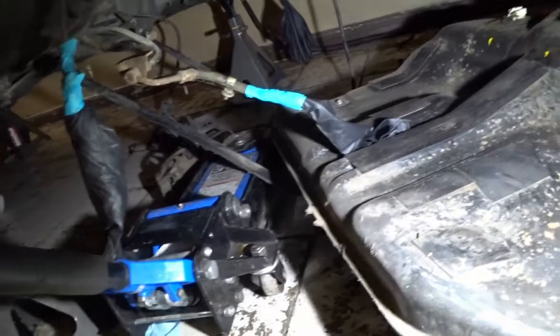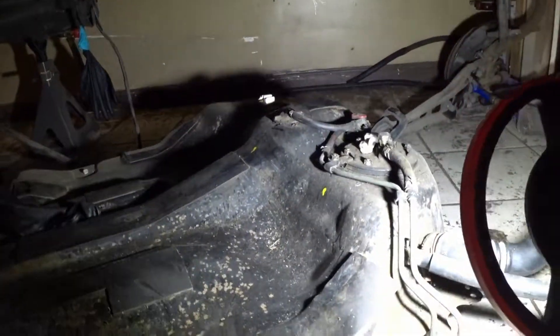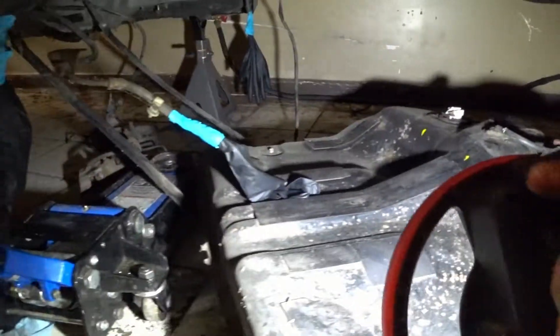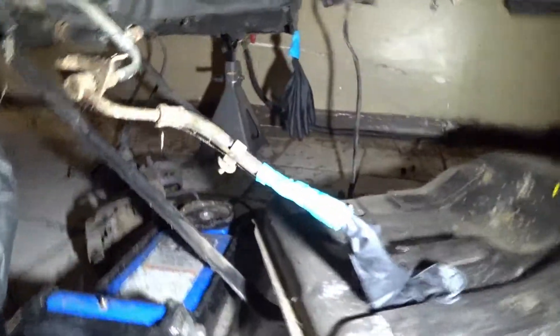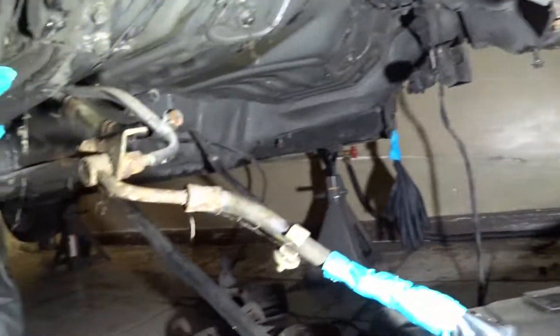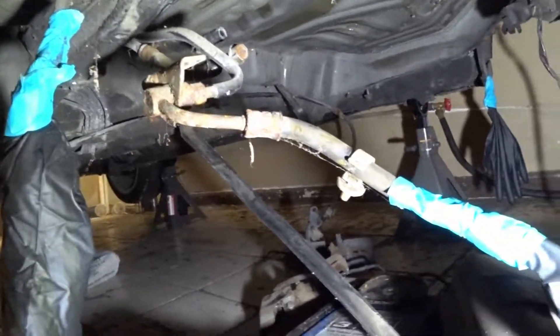That's how you take a gas tank down. If you want, you can just pull those out and change the fuel pump — there's a fuel pump hanger and that's basically it. It took me about half an hour, messing around. For those who've never seen it, this is what the underside of your car looks like when you remove the gas tank.